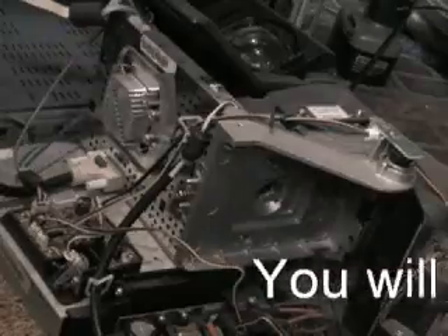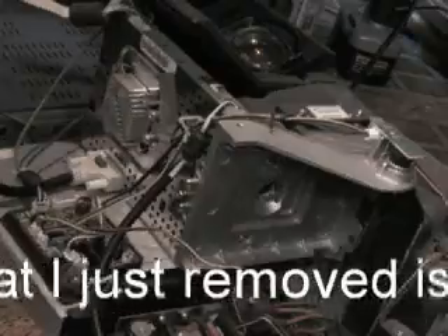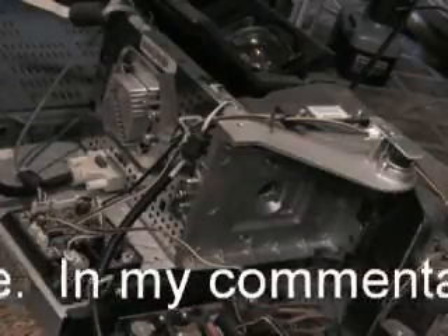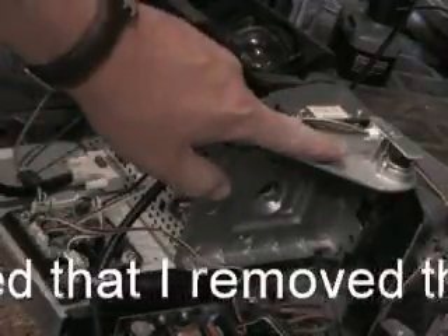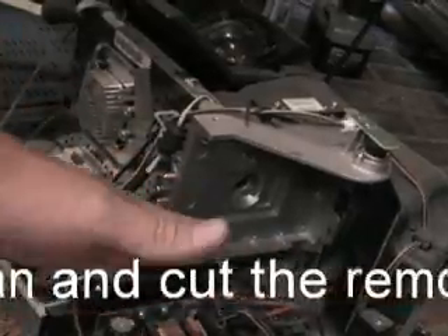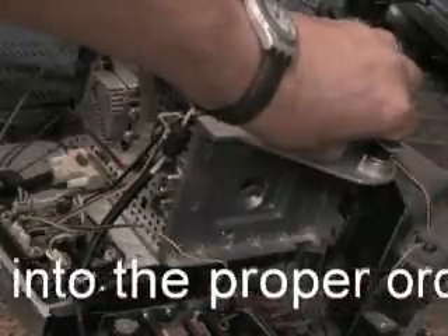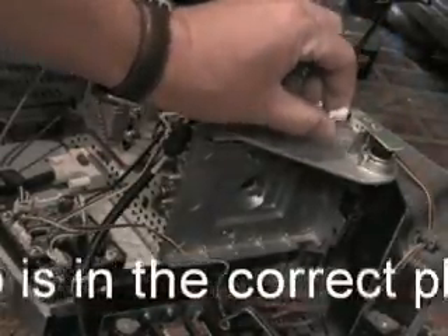So the next thing to do is disconnect the temperature wire. It's hooked up to the switch that if your TV gets too hot it shuts itself down. That's the blue and the black wire, right here. The fan was right here. The bulb slides in right here. This thing right here is the temperature control. Just pinch the connector and slide it out.